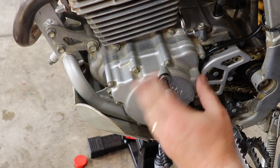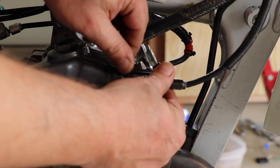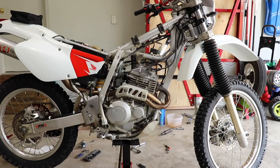Same thing with the other plug — tighten it up. Now the last thing to do would be to reconnect our decompression lever. If you have one, tighten it down and make sure it works. Then once you have everything buttoned up, go ahead and take the bike for a spin. Make sure you don't hear any tapping or any weird noises. If your bike is hard to start or even backfiring, this could be the reason why — you may need to adjust your valves. Could be carb issues or various other things, but this is where we'd start first. It's a routine maintenance procedure and you should check it pretty often anyway.